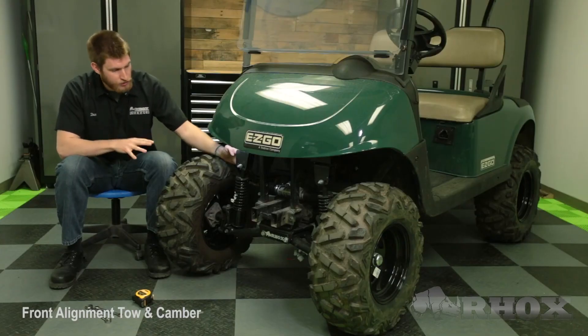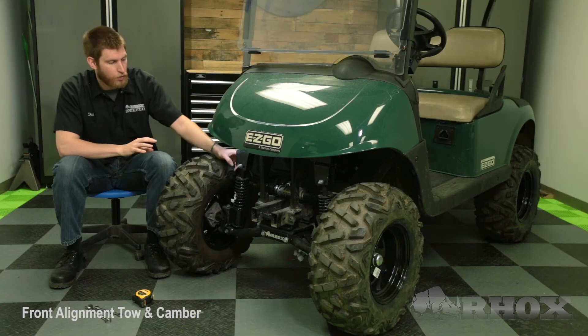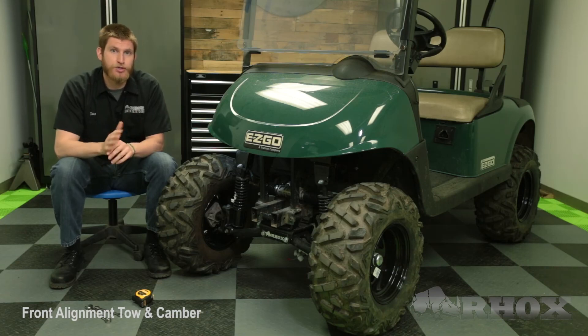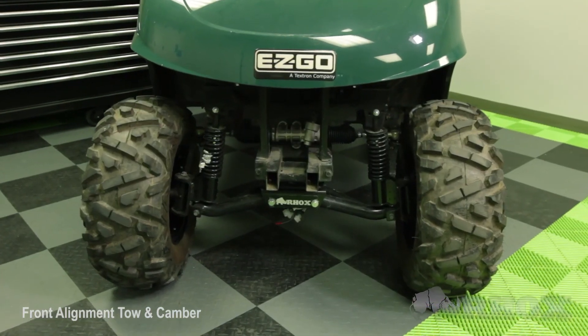Now let's jump into the camber adjustments. Making your camber adjustments is pretty much the same across the board if you have the ability to make those camber adjustments, but every cart is going to be a little bit different. With this particular cart, we have three different camber positionings. If we wanted to change the camber, we could leave the wheel on and leave it on the ground, remove the top shock bolt, pull it out, and make the adjustment to wherever we wanted in terms of our camber. Chances are, when you make any camber adjustments, you're also going to have to adjust your toe, so make sure you double check that after you've made your camber adjustment to make sure we're still within that tolerance. Once you've adjusted your camber and verified that your toe is where it's supposed to be, that'll complete your front end alignment. Just make sure that before you go drive anywhere that everything is locked down and tight to keep you safe. Thanks for watching this episode of Crash Course, and I'll see you next time.